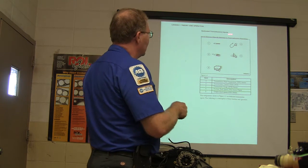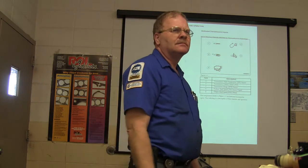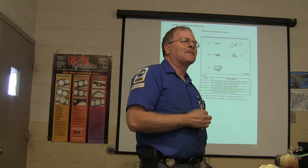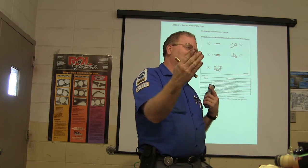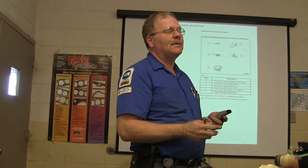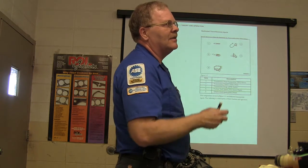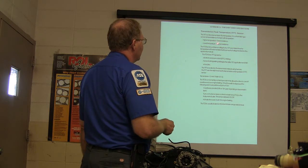There are five inputs dedicated solely for transmission that don't affect anything else. Your turbine speed sensor tells you how fast the shaft going into the transmission is turning, and the output shaft speed sensor measures the other end. If you know turbine speed and output shaft speed, the PCM knows engine speed, turbine shaft speed, and output shaft speed — some even have an intermediate shaft speed sensor. This lets it tell you things like 'incorrect gear ratio obtained for third gear.'